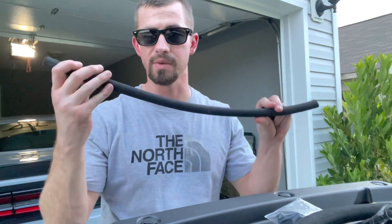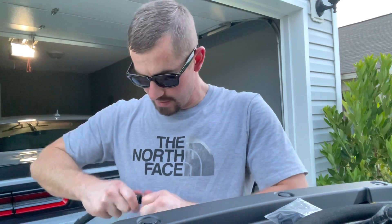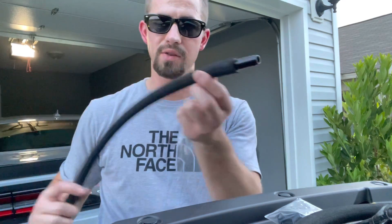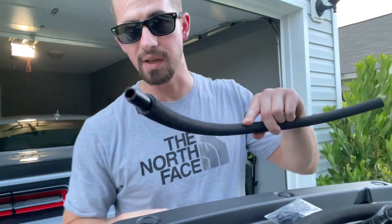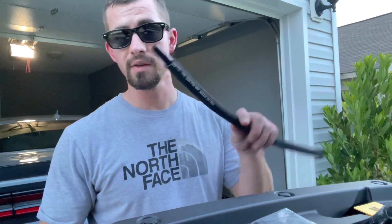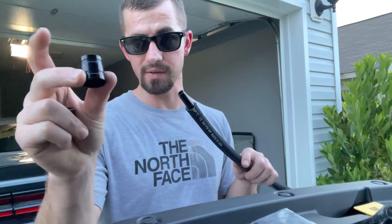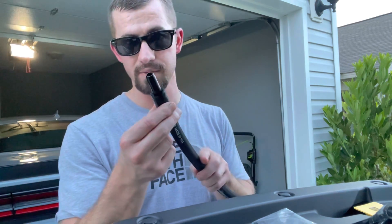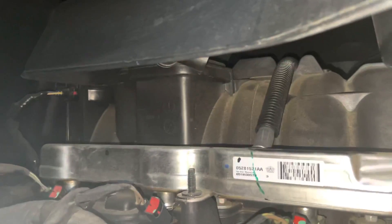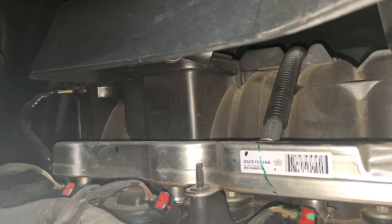Now I'm going to go ahead and pre-assemble some stuff. I'm going to take my hoses and we've got these little fittings right here. Part of it is going to go into the hose itself — just like so. We only need it on one end; that's going to be the end that actually goes into the truck. The other end will be open and that will go into the catch can. Also, another important thing: before you install this end, if you have these sleeves, you have to put those on first. Because once you install this stuff, you're going to have to destroy the rubber and the hoses to get the thing back off — and you can ask me how I know, I've been through it before.